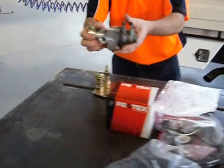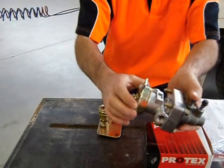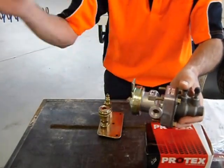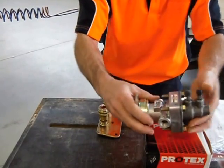There's a reaction valve that has a hydraulic signal going to these two ports and controls the blue air — so the air that works your brakes in the blue line — in here and out there when you work the brake pedal in your car.